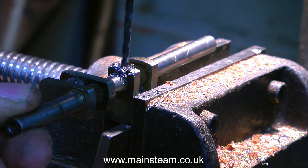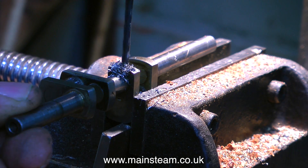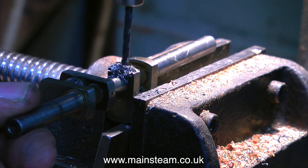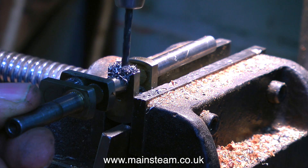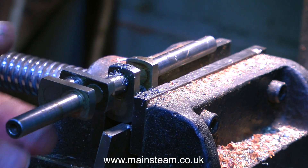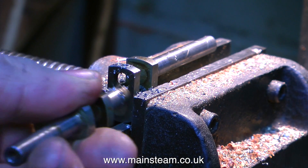But really, looking at the crankshaft, it's not that good to start with, so I'm not quite as nervous as I would be if the crankshaft was pristine. Apart from the wobbly middle bit that I'm trying to repair, the shaft itself is very badly marked. The journal part of the crankshaft that runs in the main bearings is quite badly scored. So I'm having second thoughts about this repair. But the purpose of the video is to show people how to do this job, so I will continue anyway.